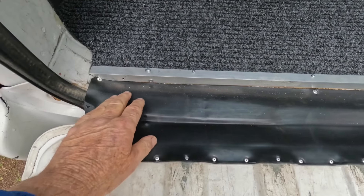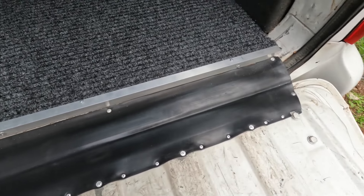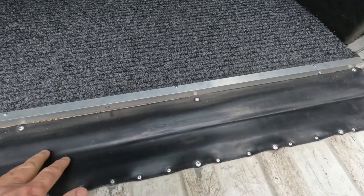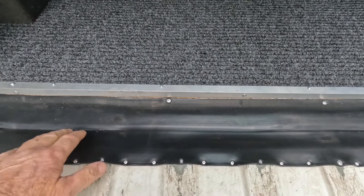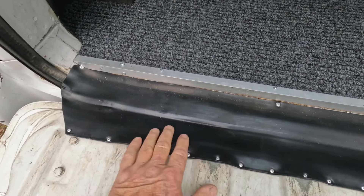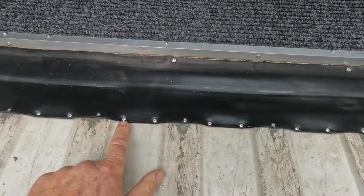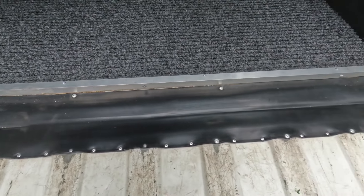There's the rubber I put on the tailgate. This is actually a special rubber — I didn't even know you could get it. Apparently it's a real big problem, this gap, when you're using the ute for commercial purposes — you know, dragging out cement or gravel or whatever — it falls in and gets trapped between the tailgate. I've pop riveted it along here and filled it with silicone, so that tidies that gap up.